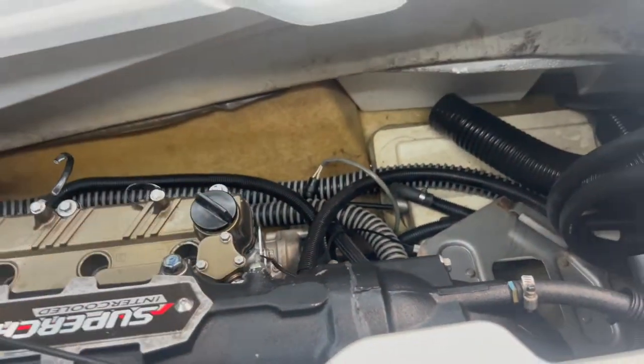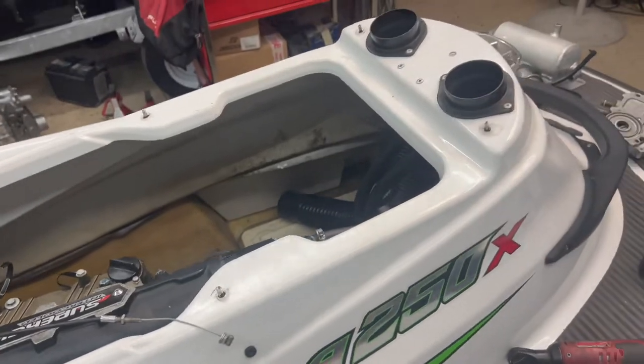So what can be causing this? It can be one of two things: the oil cooler is corroded and is blending the oil inside the oil cooler, or the cylinder head is cracked in one place that is making the water go into the oil galleries and turning the oil that color.